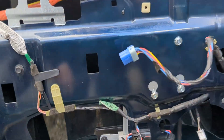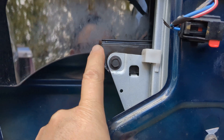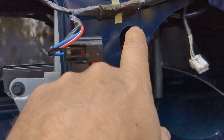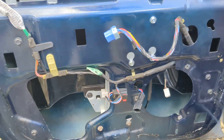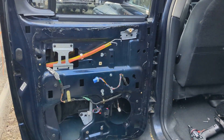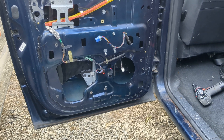Now the window's down. I have to go up just a tiny bit — I have a 10 millimeter bolt to take the glass out here, and over here we actually have to raise it up to about here so we can access the bolt through there. Once we unbolt that, the glass will slide right up out the top. I hope this helps you out — maybe you find yourself at a wrecking yard in a pinch needing the glass, instead of destroying the door or your hands trying to reach up to get to those two 10 millimeter bolts. This should help you in the future.